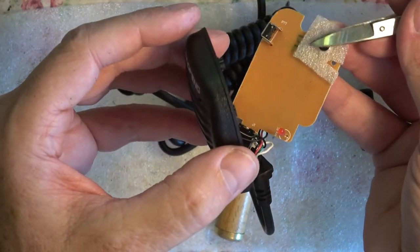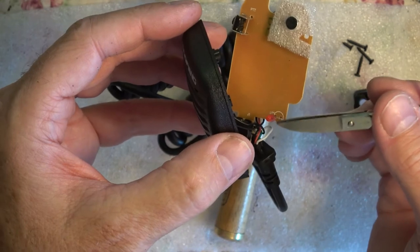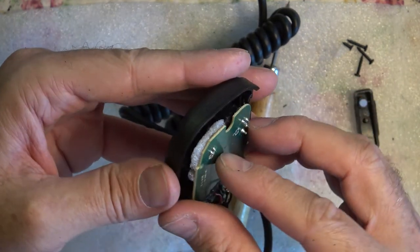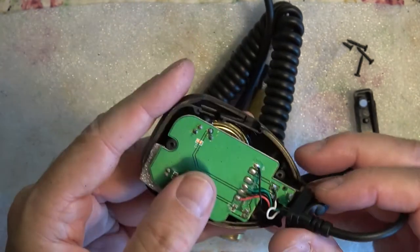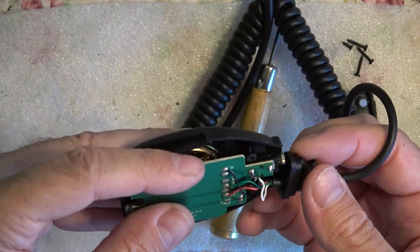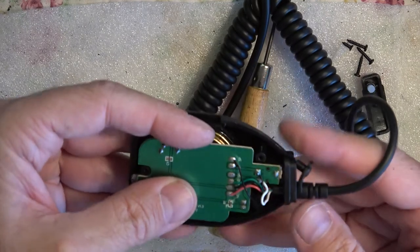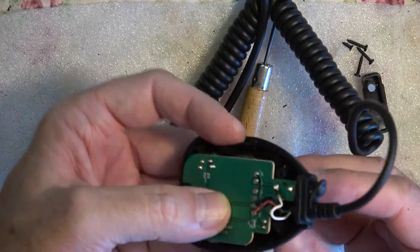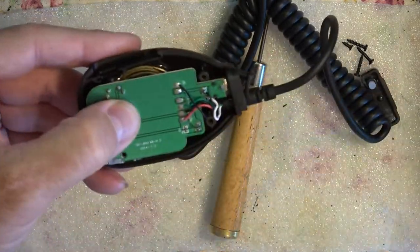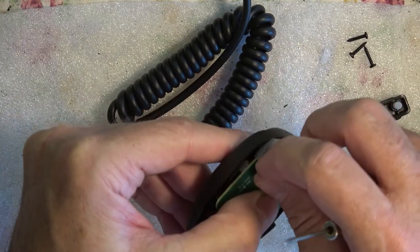Another thing to pay attention to when you put it back together is there is an LED down here that has to go back into the case's hole. Often times this LED does not like to cooperate — it will bend and you'll have to deal with it. So pay close attention when you put it back together. To simply put it back together, fit this area here. Also, the very back here, you have a speaker jack and your rubber end piece — well, it's a plastic end piece, looks rubber. You want to fit that into its notches so that it's nice and snug. The only thing holding that circuit board down is this black insert and this last screw up here. Now we put it back together by putting that one screw back in, like so.